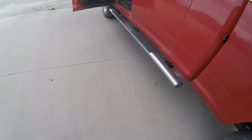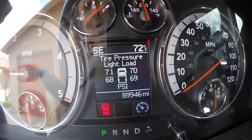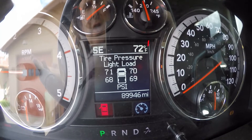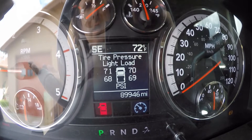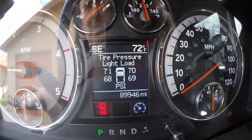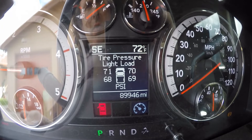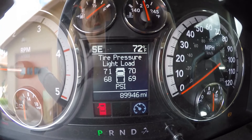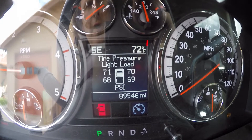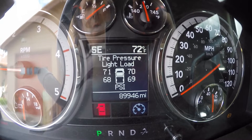So: one point, two point, one point, and no difference. Honestly, in all the years I've owned this truck, I can't remember checking the pressure on the dash and comparing it to my tire gauge to see if it was one or two points off. It didn't matter — I'd set the tires for 65, or 80 if I was towing something heavy, 55 in the rear for a light load, or 45 in the rear if I was running nothing in the back.